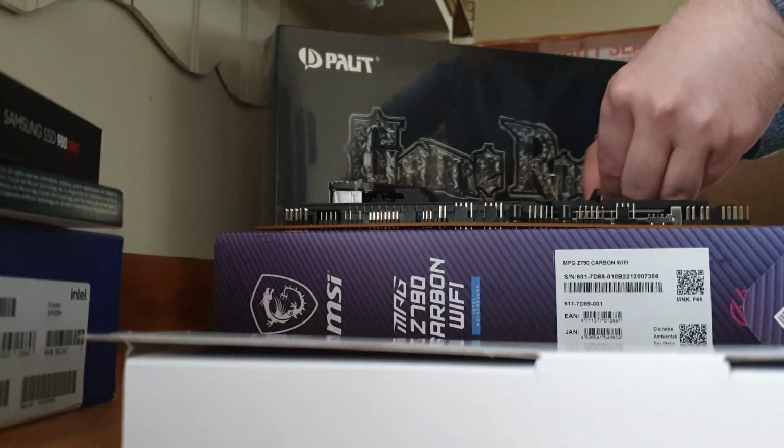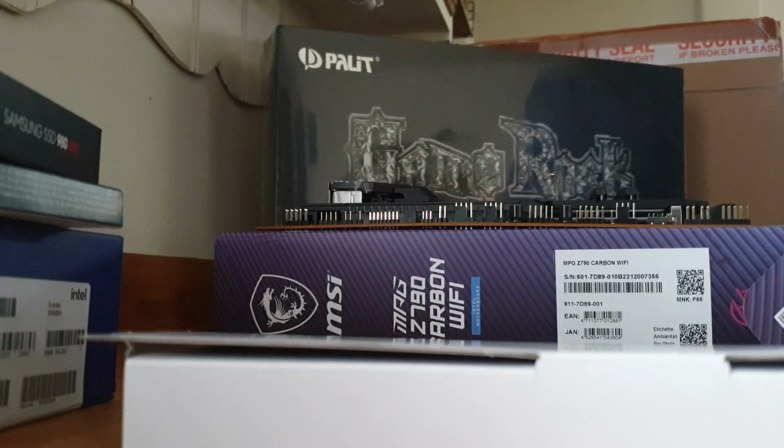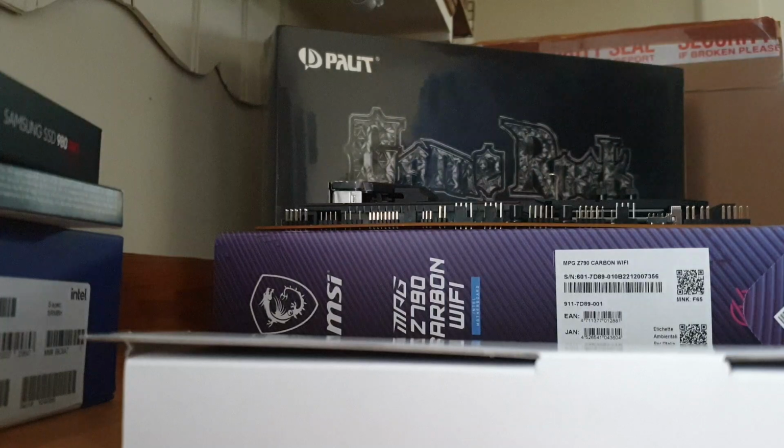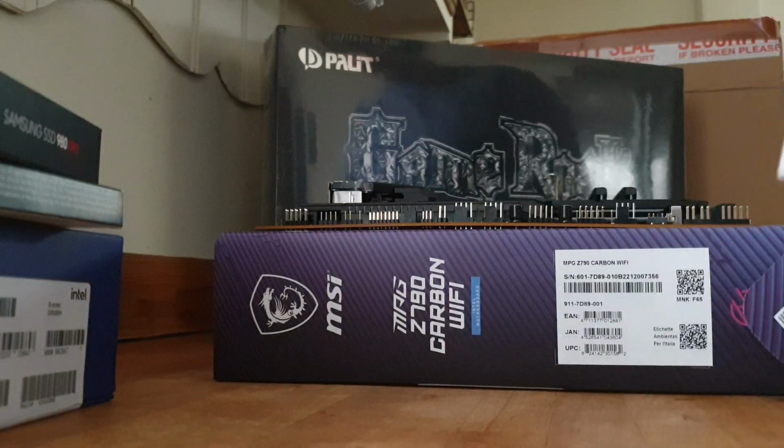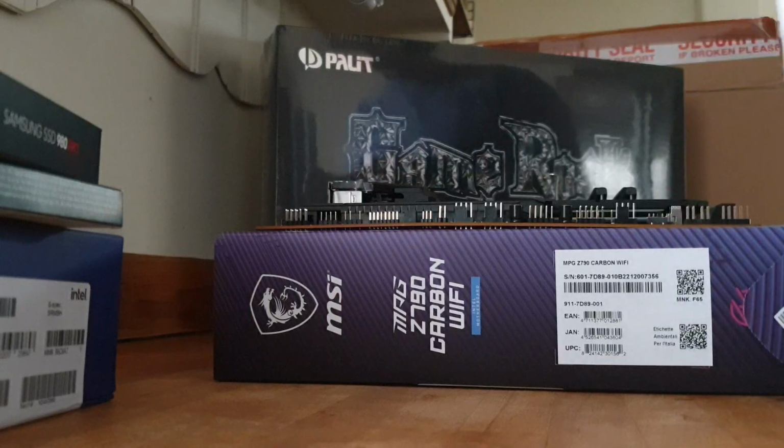Alright, nice. Put those other two back in. I went for 2 rather than 4 because it uses the same amount of power for each bay. So more bays being used means more power being used, and I want to cut down on power usage where possible. Like the 4080 is going to chonk through the power as it is anyway, so when it's at capacity, I suppose.